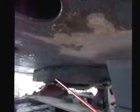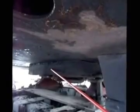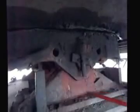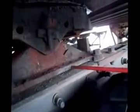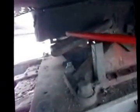And we'll come down. I'm going to make sure there's no gap between the platform, or the apron rather, and the skid plate. And I'm going to make sure the skid plate itself is not cracked or broken. It's properly greased. And all the pins and cotter pins are in place. It's also properly attached to my platform. The platform itself is not cracked or broken. It's also properly mounted to the frame. There are no missing bolts. My release handle is all the way in the locked position.